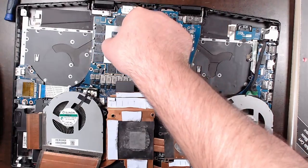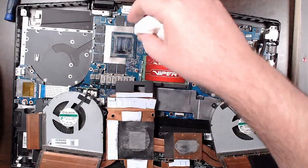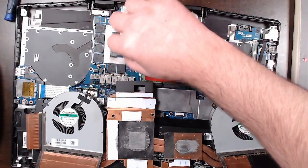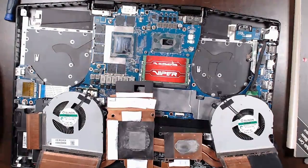I'm just using my nail here along the edge to cut a line into this old heat sink compound to allow solvent to get down beside it, because what I'd like to do is clean all that up. That way even though it shouldn't affect it, there's no question.